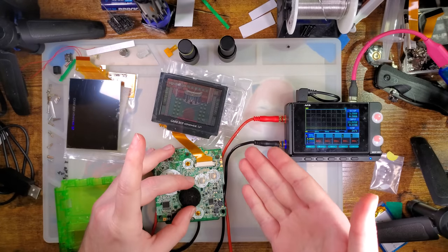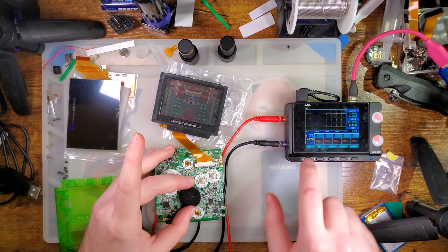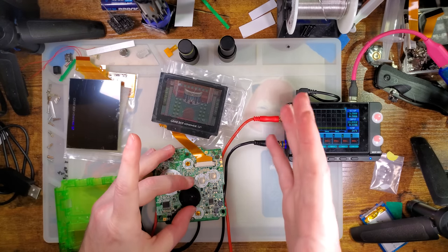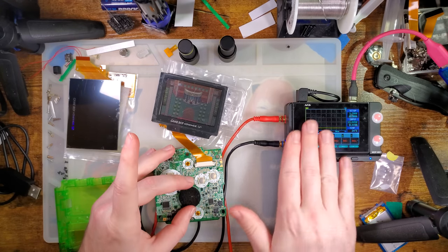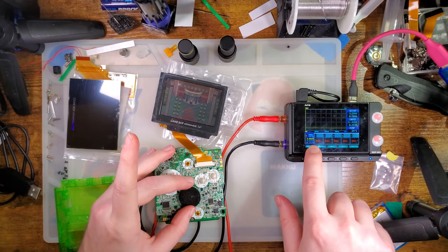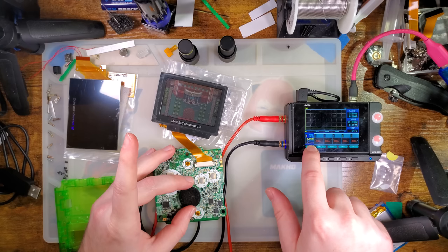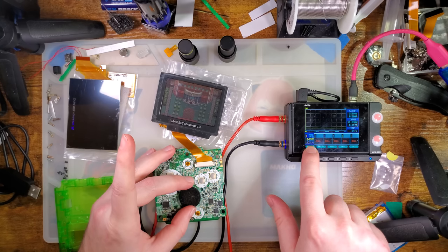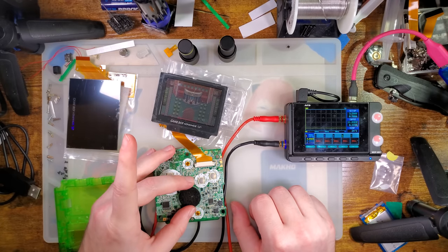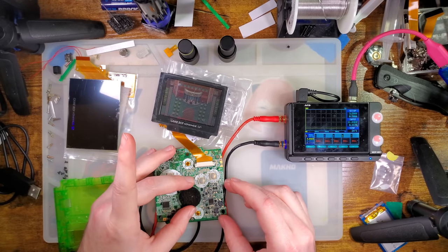So in the overworld, exact same game I'm always testing with, exact same voltage, 3.7 volts, beforehand with Pokemon Emerald, this console is pulling between 59 and 61 milliamps. If you've seen me run Game Boy Advance or Game Boy Colors, and I've called out, oh, that thing's pulling 100-something milliamps, you can't directly compare it because this is at a higher voltage. You have to compare the wattage. This thing is pulling about 0.2 watts. So it's about the same as any other Game Boy, just higher voltage, lower milliamps.